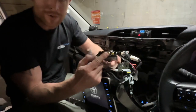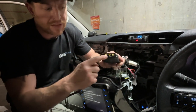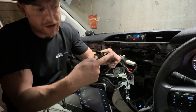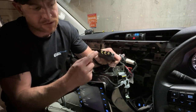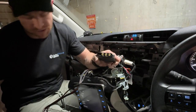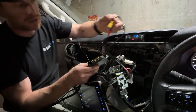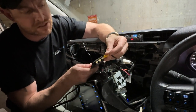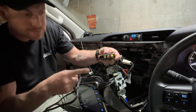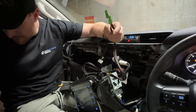These are your camera outputs. So that's the original camera turn-on - you can actually turn your factory camera on anytime while driving. Then you've got an option for three additional cameras. Camera two is the one on the far right hand side. If you're looking at these RCAs you'll notice there's a bit of gap on the left - camera two, three, four. We didn't get enough time to do casings for these, but we thought we'd get these kits out to you ASAP because everyone waited so long. I'm going to show you how it would work - we've mocked up a secondary camera here. If you put your second trailer or caravan camera into camera two, that would be your installation.